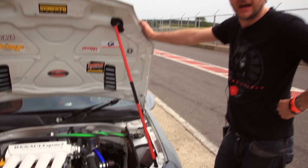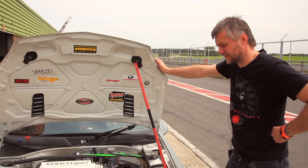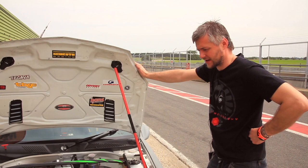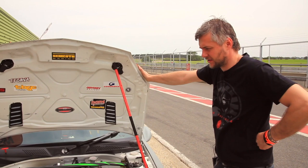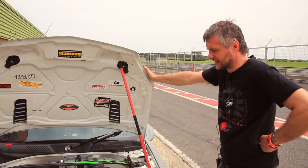It's running a DTA S60 Pro ECU standalone. I did all my own — I want to call it motorsport wiring. It is kind of motorsport because I've used all the motorsport components, but since I've never done it before I can't really claim it's motorsport. But it is a dedicated wiring loom for the engine and for the interior. Essentially, there is almost nothing left from the original Clio apart from a few little bits and the engine.